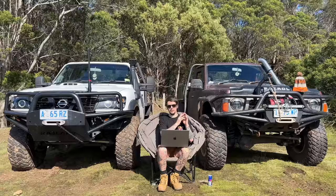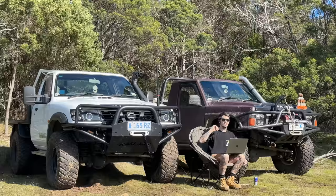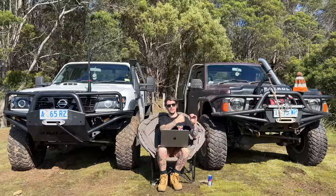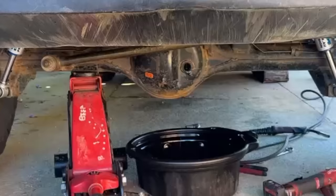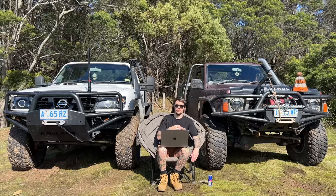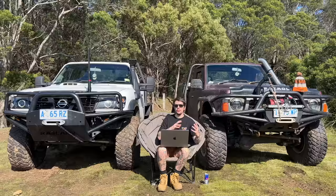Tyler and TC told me on the $1,000 track that only one of my rear tyres was spinning. I even got a message from Jesse Gleason saying my rear lock was not working, which was really awesome. But I never got around to actually replacing that dog. Right before the East Coast trip with Tyler, I found a dent from the inside of the diff, which looked like a piece of metal had gone around the tip of the crown wheel and dented it from the inside. We dropped the rear center before that trip and found all the bolts in there. While I had it out, I put the new dog in to see if that would improve anything. And so this is when the saga starts of the bolts walking out.